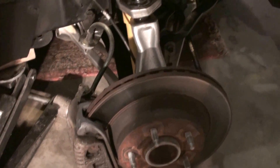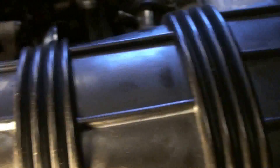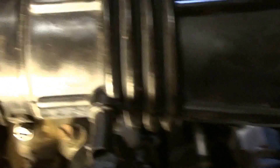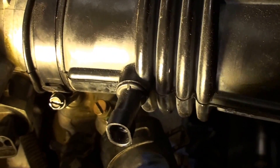We're on the passenger side of the car. I've got the wheel and tire removed because I'm working on this thing. Let's start up front here. We've got the air box — that's where the air filter is — and that comes along here to the air intake. Right here we've got the air temperature sensor, which measures or lets the ECM know what temperature the incoming air is.